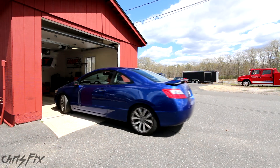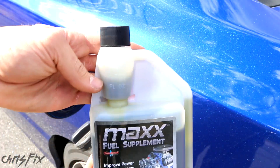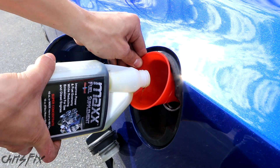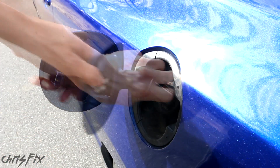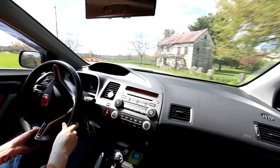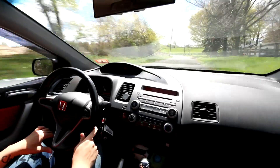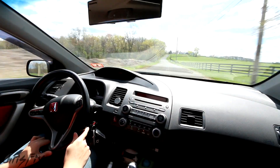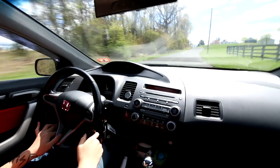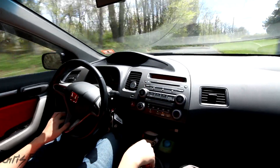Let's back out of here and add the fuel supplement to the gas. According to the directions on the bottle, you use one ounce for every 30 gallons of gas. This tank is a 13-gallon tank and it's about half full, so a half an ounce will be more than enough. Now let's close everything up and go for a ride. We're going to go for a 15-minute drive to get the Clean Boost Max mixed into the gas, and also use up the gas without Clean Boost Max that's in the fuel lines and the fuel rail. We're not getting new gas — we're going to keep the gas in the tank and go for a ride to stir it up and mix it.